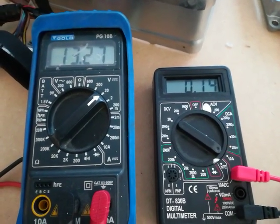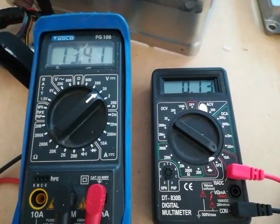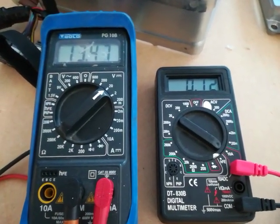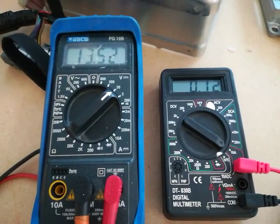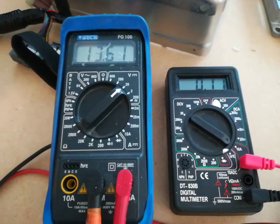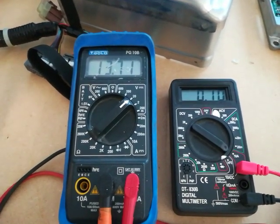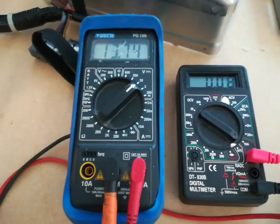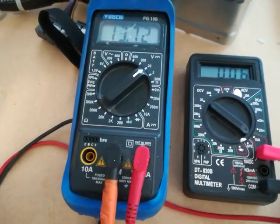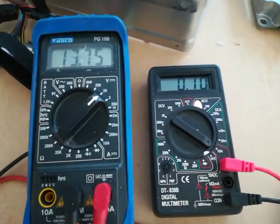I shall check the resistor temperature in a moment — it's not smoking yet. Now the voltage is probably almost down to less than a volt difference between the full stick and the low stick, so now it'll be a much slower transfer of current. Even in this worst-case scenario with the massive difference in voltages between the full and empty sticks...